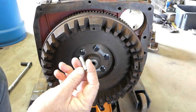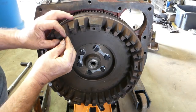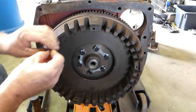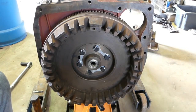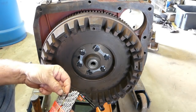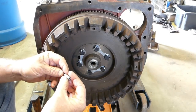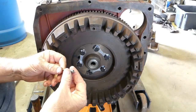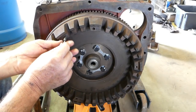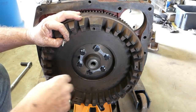So I have a rigid bolt removing set. Some of the bits are missing now, but what we need to do is pop this guide there, and then with that guide we can find a drill here, and I think it's 3.2 mil or it would probably be around 1/8, and that drill is snug down through the center there. So the idea is to hold this in there nice and true, get the drill and make sure we drill a center in the bolt.